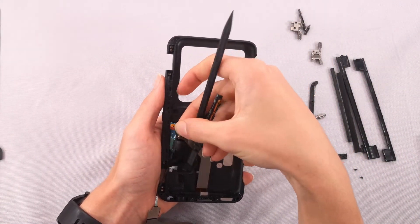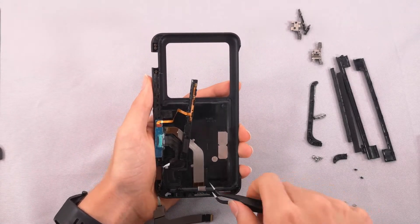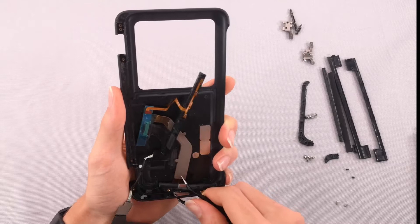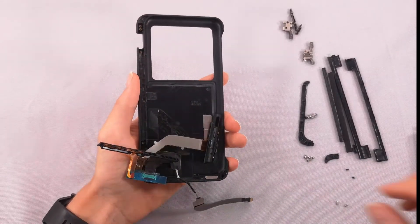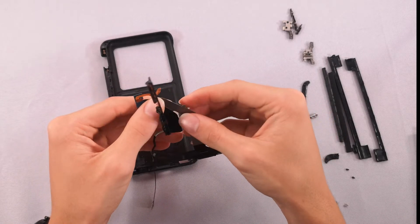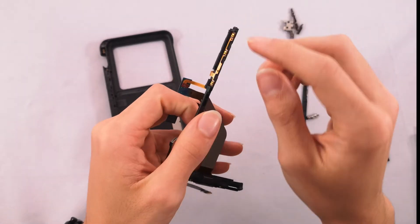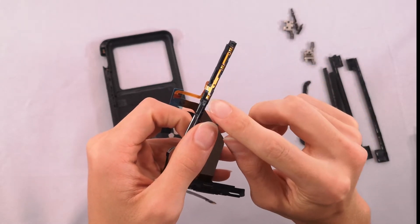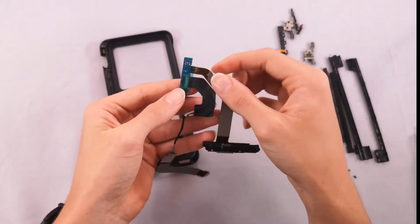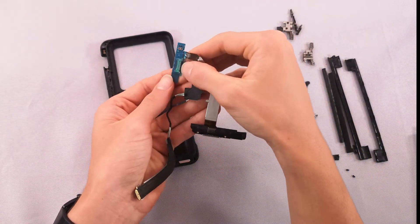I was correct and I found this blue motherboard over in the corner. Now all I have to do is remove the charging port and this whole section should come out. Right here you can see the small motherboard connecting them all together. These are the volume buttons and the Google Assistant button. I'm going to quickly remove that, and we're also going to remove this cord right here, but there's some blue tape covering it so we're going to have to peel that up first.